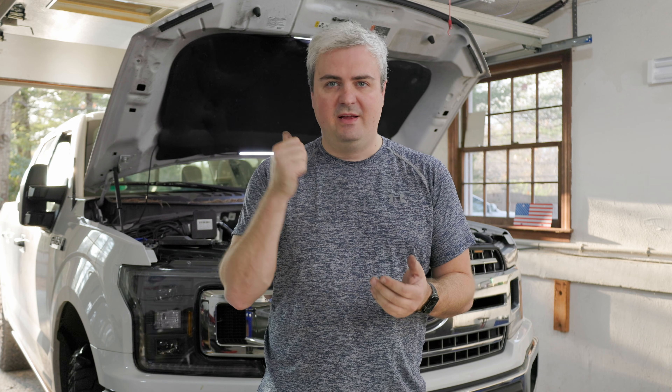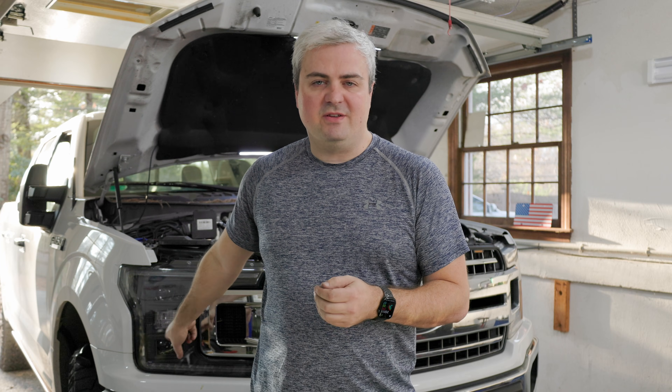The testing is complete and all my readings are on the pretty high side - probably higher than I expected. I turned off the fuel by removing the fuel pump fuse, took the ignition out of the process using the auxiliary starter switch between the solenoid and the battery, and everything looks much higher than I would expect - all compressions are above 230. If there's anything I'm missing, let me know in the comments.